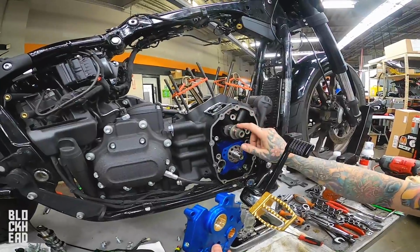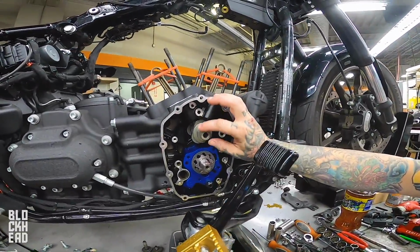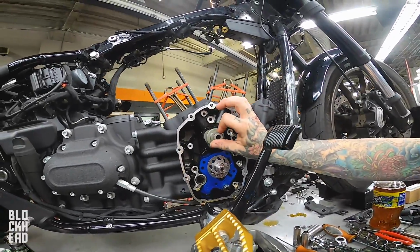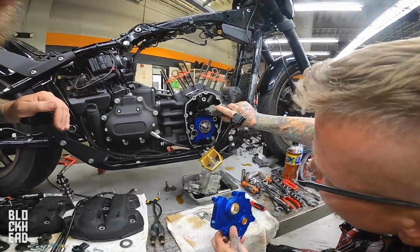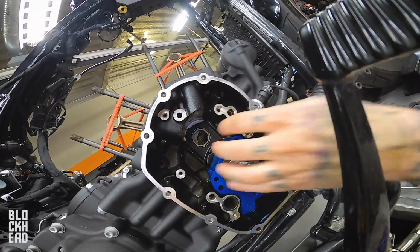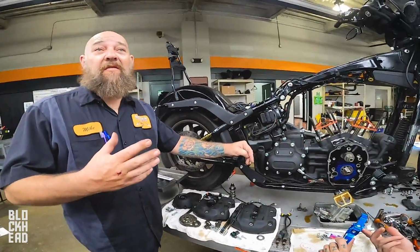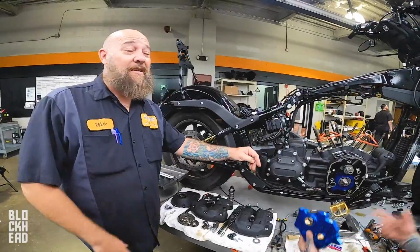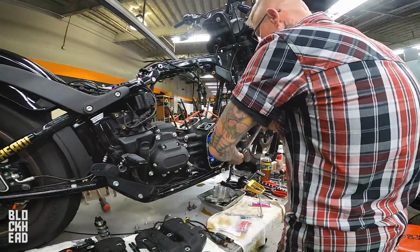Here, turn the cam again, since you were talking about the clearance in there. Nice. If I pull this out, you can look on the inner part of the case. See where they actually machine that? That's clearancing. It's gotta be enough that it clears, but not so much that it's gonna crack. Yeah, you don't want to compromise the structural integrity. Right.